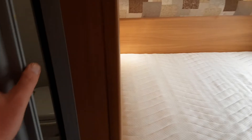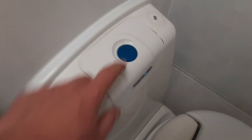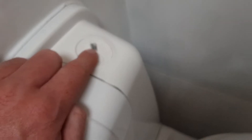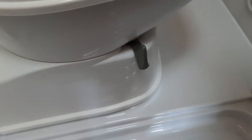The last thing to go through is the toilet system in the bathroom. To flush your toilet you have an electric flush on top. You have a toilet full indicator light that lets you know when the waste cassette is completely full. The toilet seat itself turns for your convenience, but when you're removing the cassette from the side of the van, you need to make sure it's back in the standard position. Below the toilet you'll find a grey waste handle — push it open and the waste will go into the cassette; when it's closed, it won't. When removing the toilet waste cassette from underneath the van, make sure this grey flap is in the closed position.